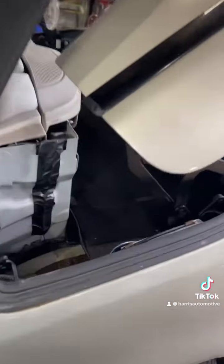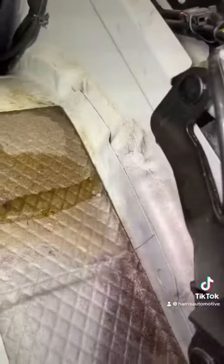I don't want to get stuck with the roof in a crazy position. Look at this — I got the top open partially and I heard all this bubbling coming out. Got a leak here at this cylinder. Wow, that is a hell of a leak. Let's check the other side, because a lot of times — look, we got fluid over here as well, leaking from this cylinder here.